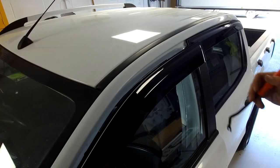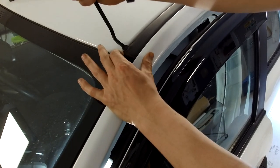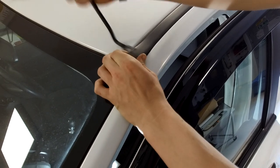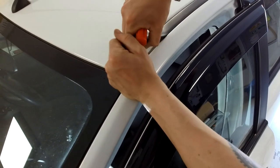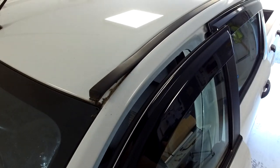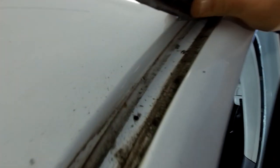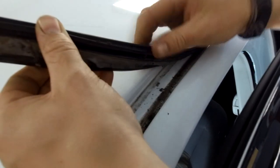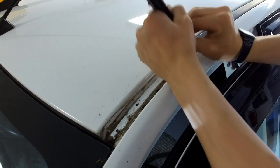We're stood on a chair and pulling out this rubber trim. Use a plastic trim tool to get under that back edge — it doesn't take much force. This strip is rubber with a bit of aluminium in it, so you don't want to buckle it too much. Pull it up and you can see our two holes through the top skin. It's held on by double-sided tape, and the marks where we drilled give us a good idea of where to cut the rubber.